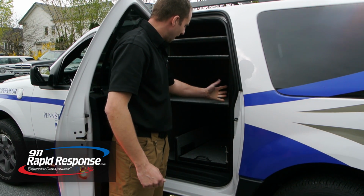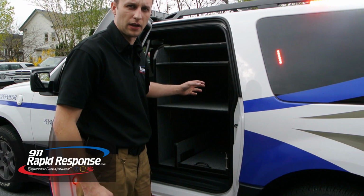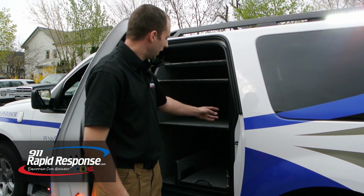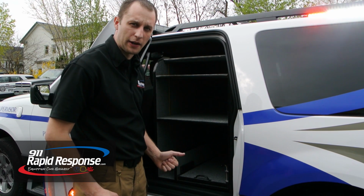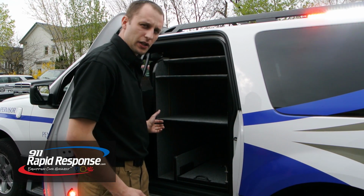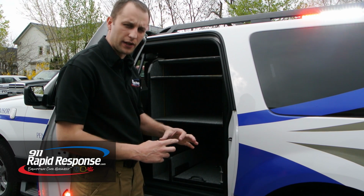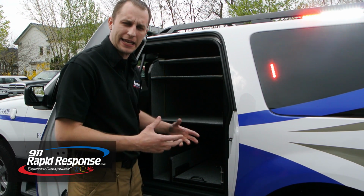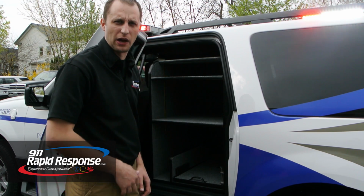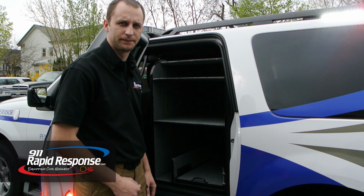The box also has LED lighting in the box, which comes on with the interior lighting on the vehicle. So it's all set for relays and comes with interior lighting. The front side of this box makes a very nice mounting platform for us because it lets us mount all the radios and all the siren boxes, easily accessible, with a nice fuse block that will also be labeled for the customer in the future if we need to add anything, and we give them some spares as radios and other equipment change in the years to come.